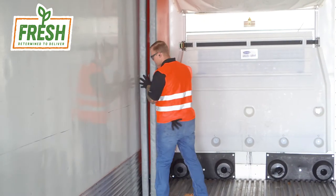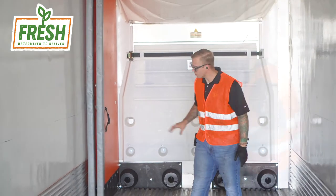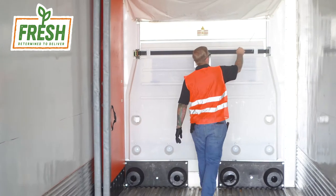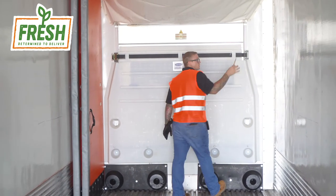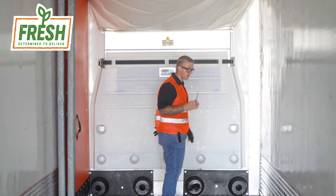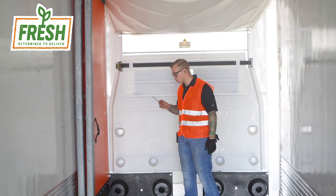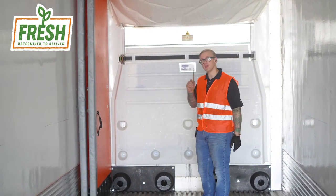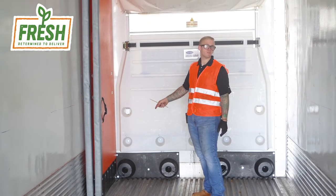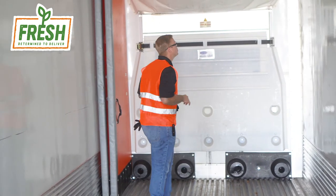Check your loading items — this is a bulkhead. Make sure it's not torn and no damage is apparent. As you get to the head of the trailer, keep an eye out for debris. This is literally a wood chip from a pallet that snapped and got caught up there — that's a big piece to find. As we checked the hose drains earlier, we saw some wood chip pallet debris fall out of there. It's something to be cognizant of as you're doing your pre-trip.